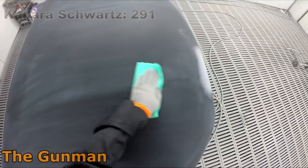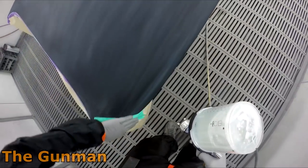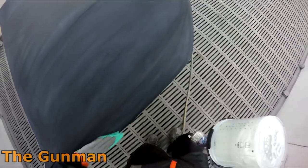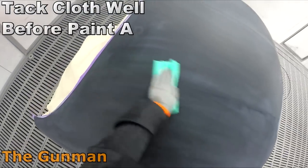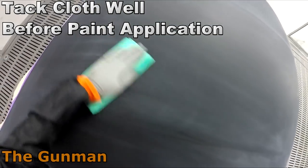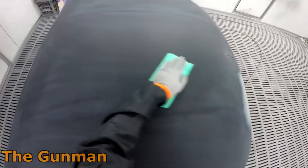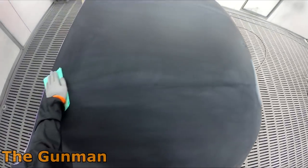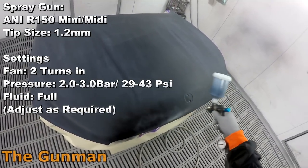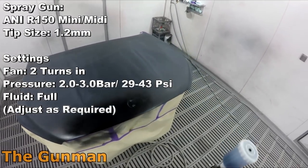All of that aside, I've already done a bit of a repair. It was a decent sized chip taken out of this bonnet. Being that it's a brand new car, we obviously had to fix it properly. I just feathered it out with some 320 grit on the orbital sander, and then put some UV primer onto it. From memory, I just threw this bonnet into the sun, because the sun just so happened to be shining into the workshop that morning. I whacked that UV primer, which I'm spraying my base coat over now, into the sun, and it was dry within a couple of minutes.